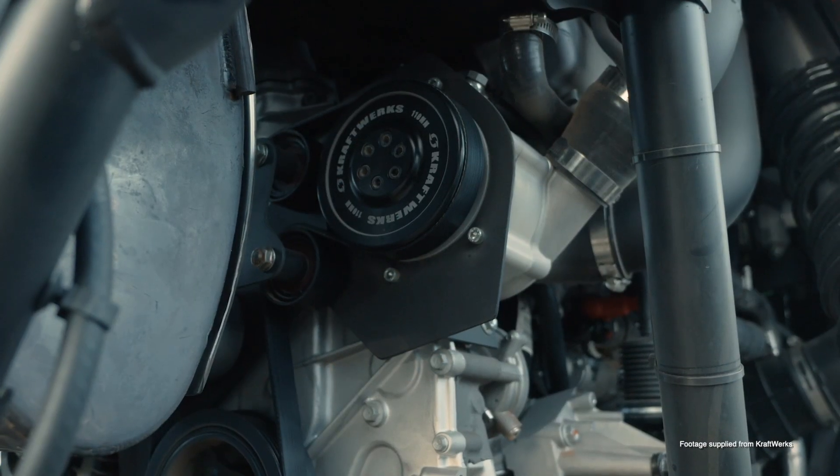What is the difference between a supercharger and a turbo? The style of supercharger that we use is basically like a turbo kit. The only difference is a turbo is obviously ran with exhaust gas, and our superchargers run with a belt off the crank.